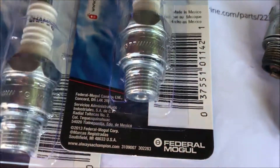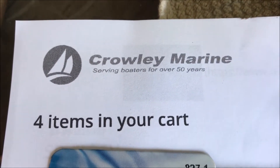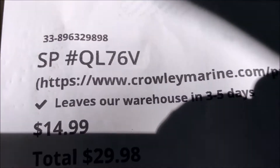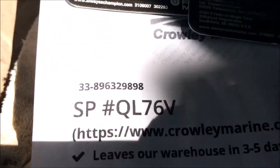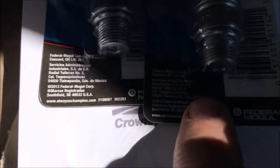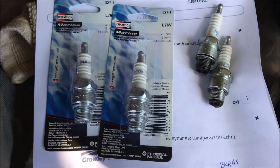I'm encouraged because when I look at the new plug — the L76V that's called out — I always go to Crowley Marine, type in the serial number of the motor, and find the parts. They said the part I wanted was a QL76V, which is what it says right here. They probably wanted $7.50 a piece for them, but my local O'Reilly had them for $4. Because the technology is different — there's no solid leg on the electrode like you have on the two being replaced — I'm hoping when I put these new plugs in, everything takes off and goes.